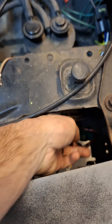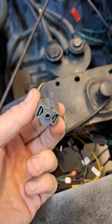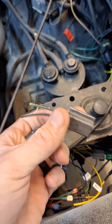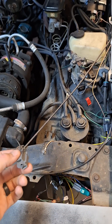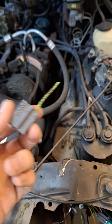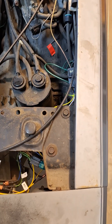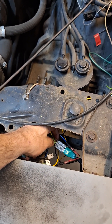I cut the pigtail off the high beam. The high beam came with this plug as well, but I only had this connector and didn't have access to a junkyard when I was wiring these in. The other solution is to find another old Chevy — or anything using four-by-six headlights — and snip off some pigtails. It's invaluable; I'd definitely keep some on hand.